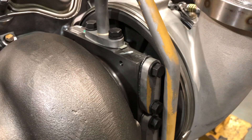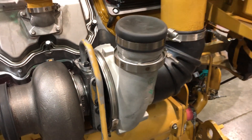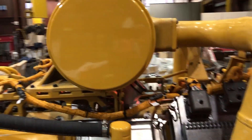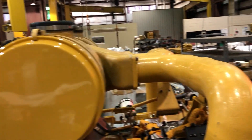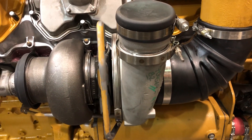Look at the different oil feed ports they have for this turbo for other applications. There's that air tube — that's where air gets sucked in right there, gets cleaned through the air cleaner, goes down here right into the compressor wheel.